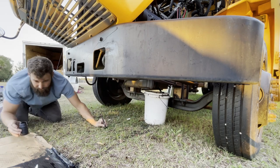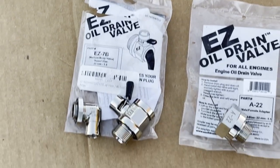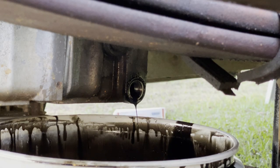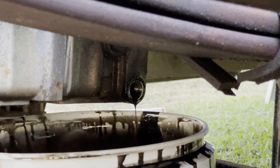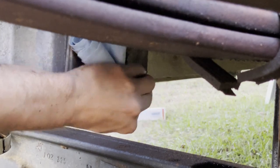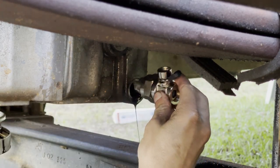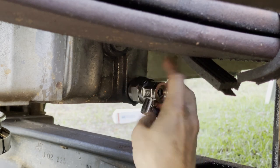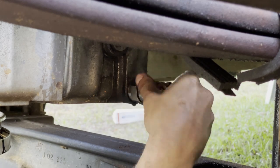Now I have an oil sample, which I will send out for analysis. Okay, we're going to install an easy oil drain valve — I've been using these for a couple of years, three or four years now. I've got it on my shuttle 7.3, and I'll show you how this works. Two of those parts went right together just like this — they have O-rings sealing them together. It looks like this one is just as simple as turning it and snugging it down. I'm going to put some oil in there, and with that easy valve secure in place, make sure it doesn't leak overnight before I fill the entire thing.